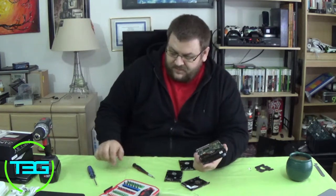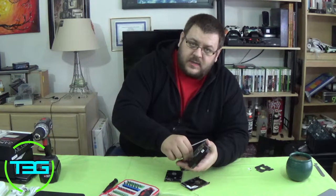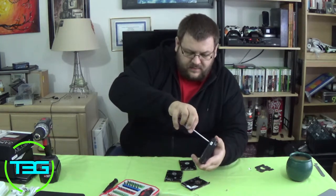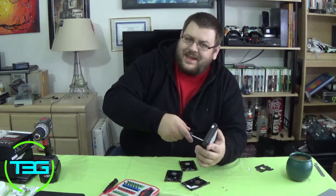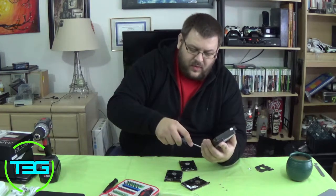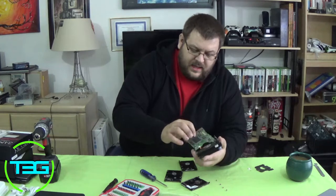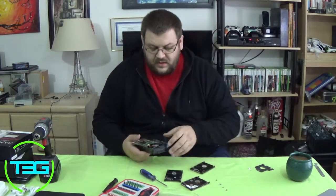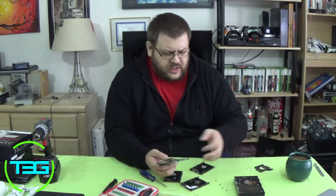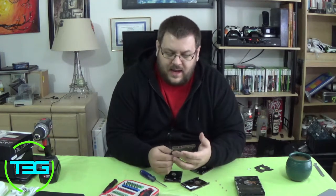The reason that's true is that these boards have a tiny control chip on them that identifies this particular drive to this particular board. So for instance, this is an older IDE interface hard drive. That chip identifies the drive uniquely. These actually connected with tiny pins here, and this one is going to connect with a ribbon cable. This is an older one, so it actually has some more traditional connectivity, including some pin connections. This used a ZIF interface - zero insertion force - that just snapped on without any actual effort.